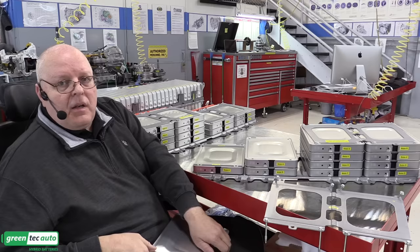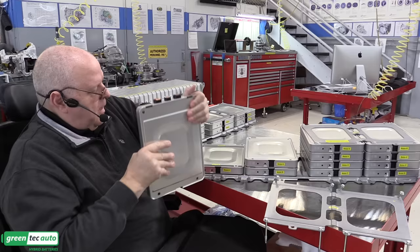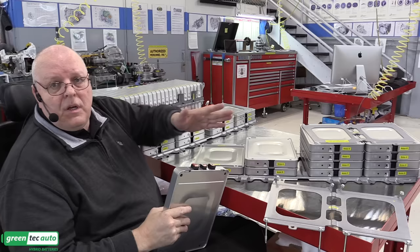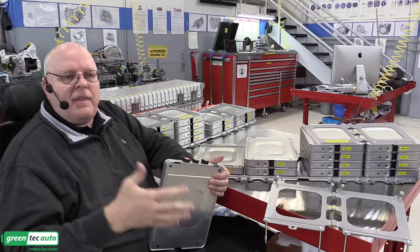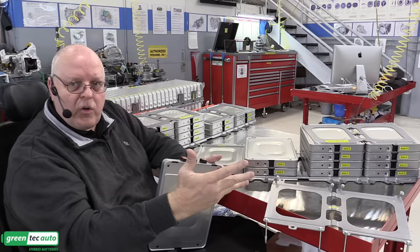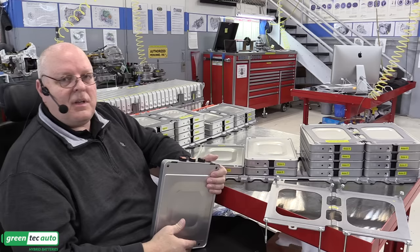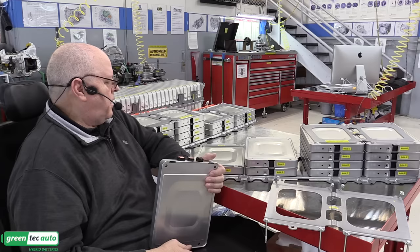Now, you can transfer heat, if you remember from basic physics, at least my basic physics, through conduction, where we physically touch some item that's hotter to something that's cooler, and the heat transfers to the cooler item. There's convection, where something is really hot and it heats the air up around it, and then the air dissipates the heat. And then there's radiation, like the sunlight, where there's heat being transferred as long as you're not in a shadow. Well, the majority of the heat transfer through the Nissan LEAF battery is conduction to the outer housing and then convection to the air. And that's it, which is unfortunate for the design as it's turned out to be.